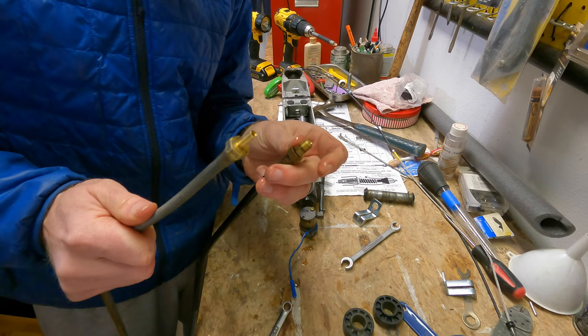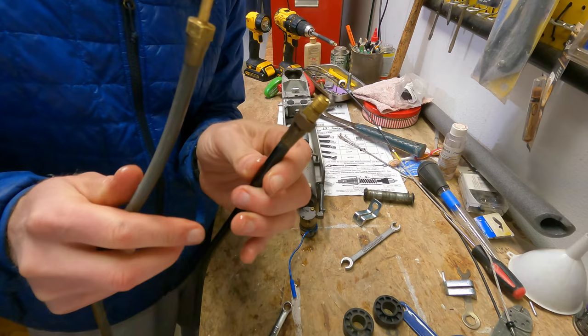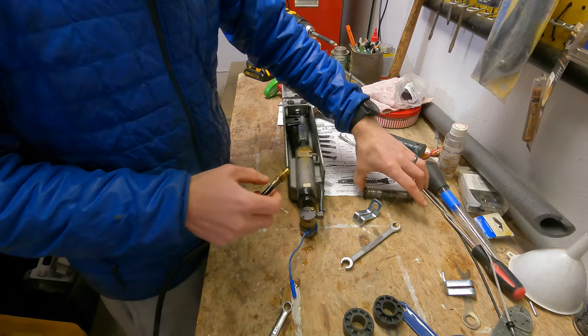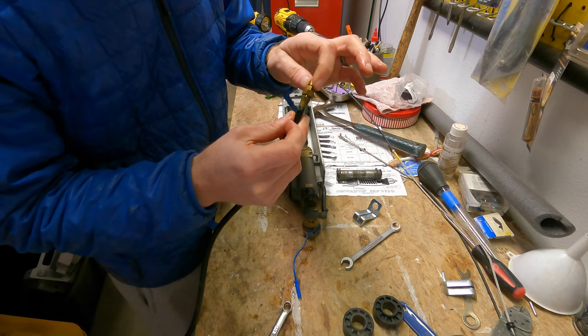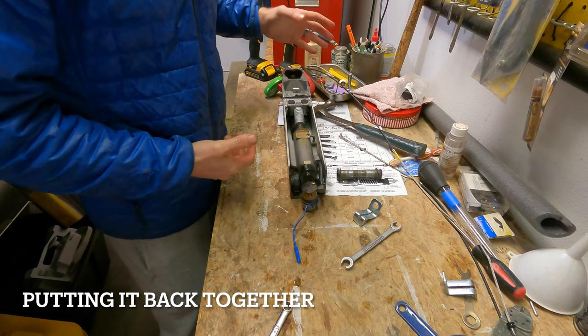I'm not a mechanic at all, and I ended up doing this — which is very bad — because it has no more flared head on it. So I am also going to be replacing my whole cable. I'll put a link to that in the description if you happen to be in the same boat. But if you listen to this word of caution you shouldn't be. Make sure you keep your pins in and disconnect your brake line first — that would be my suggestion. That way it won't be sloppy when you're trying to undo this. And if yours does have a hex head like this — I have no clue why they put that on there — do not touch it. Go for the little one.